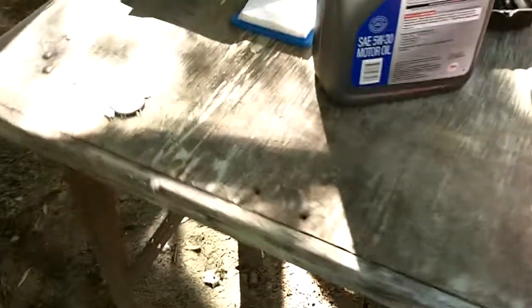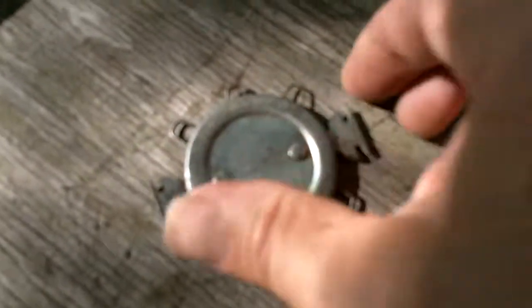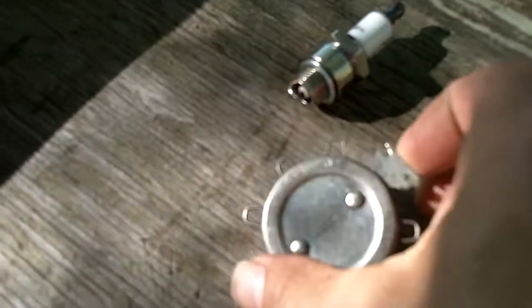The recommended space is .030 inch. There's a spark plug gapping tool right here. This wire — .030 is the one that represents what we're trying to do. This is a little tough to do since I'm holding the phone in one hand, but that size wire is just one basic type of feeler gauge. That should fit in between there kind of snugly, but it should still fit — and it does.